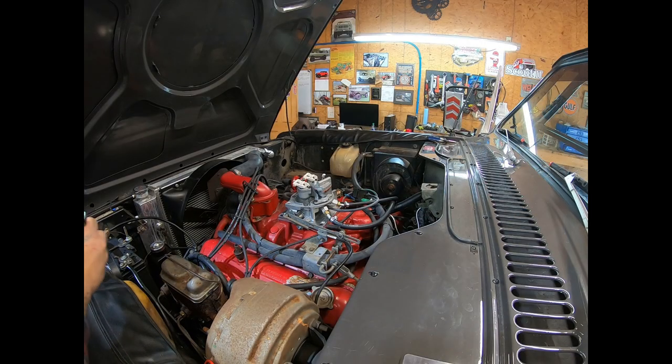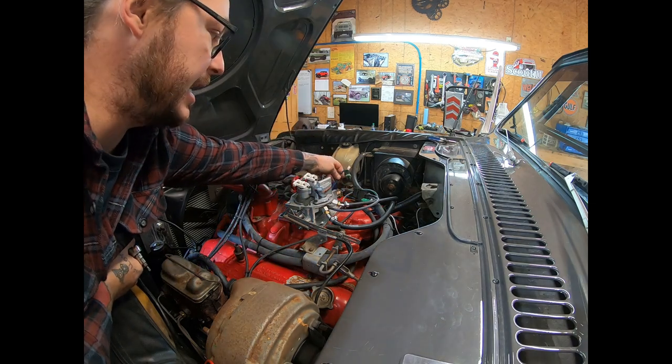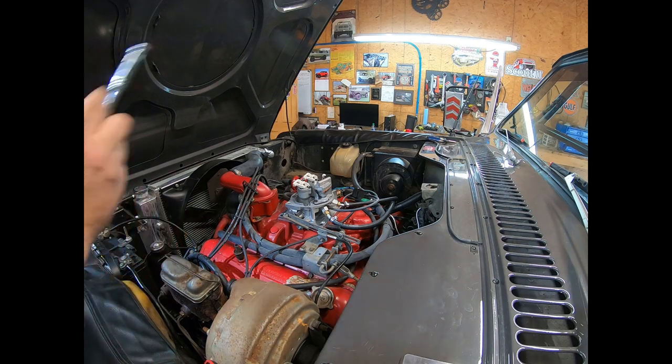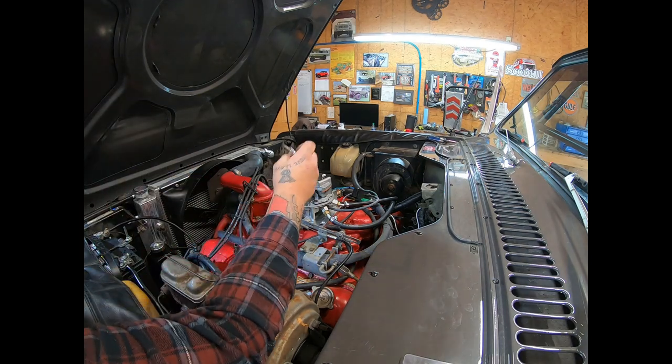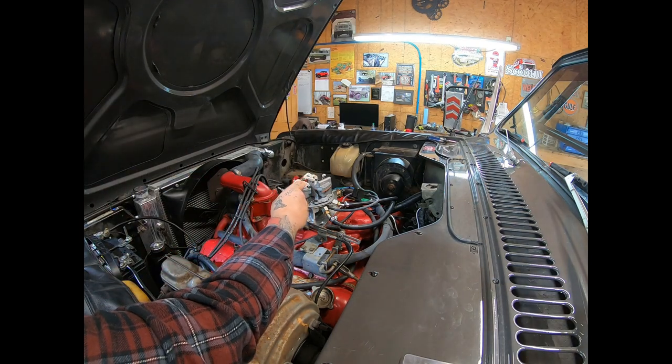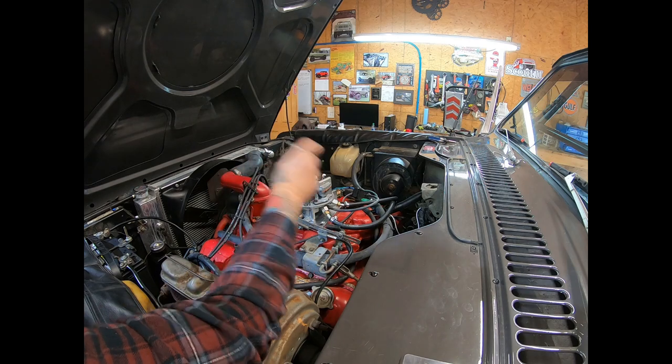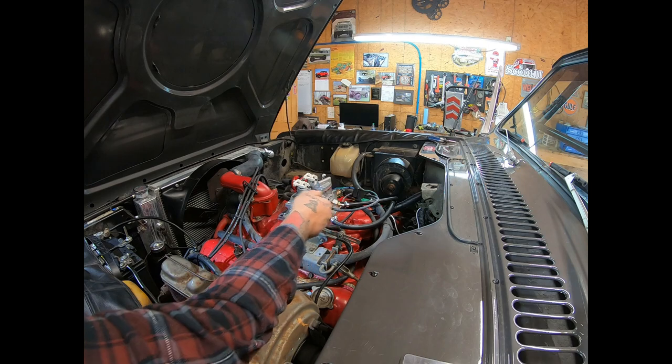All right, again, the IAC plug is disconnected. The jumper's removed from the ALDL plug, and or the diagnostics plug. What we're going to do is adjust the idle screw till it maintains a good solid minimum idle speed without any assistance from the IAC.